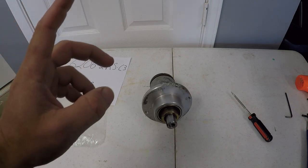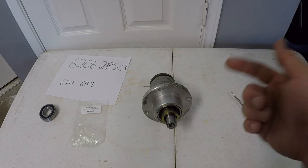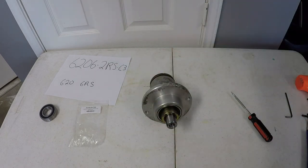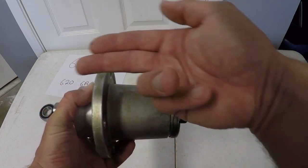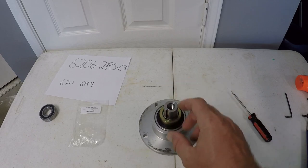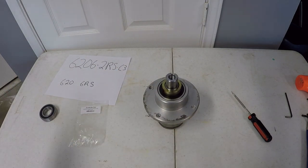To get to this point, I'm not going to cover this in the video, but basically just remove your spindle covers on your deck — easy enough, just wrench that out. To get the belt off, you'll pull up on the belt and turn the pulley, and that belt will fold right off. When taking the pulley out on the Bad Boy, it is not a through bolt, so you have to unbolt the blade, then unbolt the pulley from the top. Once you unbolt the pulley, you'll remove the little lock collar nut. All of this was covered in the other video, so go watch that Bad Boy spindle replacement video.